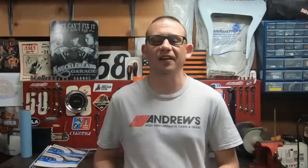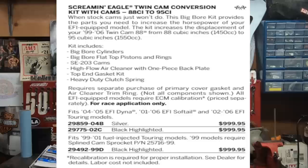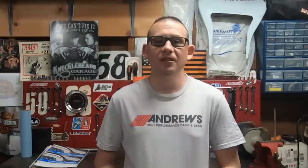What Harley did do with the factory 95s was increase the compression ratio from 8.5:1 on the 88s up to 9.4:1 on the twin cam 95s. Harley has long offered a 95-inch kit through Screamin' Eagle — good cylinders, good pistons, comes with all the hardware and gaskets. The only thing holding it back is the Screamin' Eagle 203 cam. Harley claims 98 foot-pounds of torque and about 80 horsepower with that setup. The SE203 is a good mid-range high-torque cam, so 98 foot-pounds looks good, but the horsepower is only around 80. For a thousand dollars, that's pretty steep when you could get an aftermarket cam like the Wood TW6, which makes about 92 foot-pounds of torque and roughly 80 horsepower at a fraction of the cost — $350 to $500 versus $1,000 to $1,500 for the complete Screamin' Eagle big bore conversion.